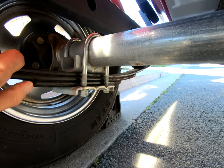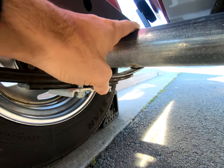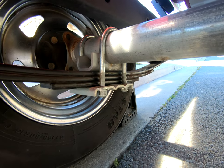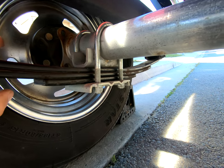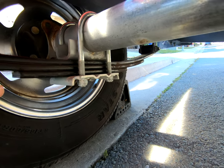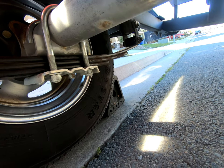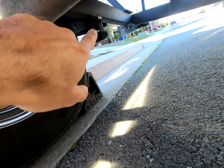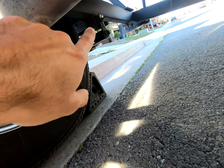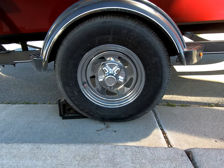It was very easy to change out — I did it with just a bottle jack. The hub assembly hangs down after you pull the tires and springs off, and it's manageable weight while bolting it all up. If you get leaf springs that are a quarter inch or half inch longer, no problem — the rear hanger is flexible, just unbolt it a little, move it around, and it turns out good.